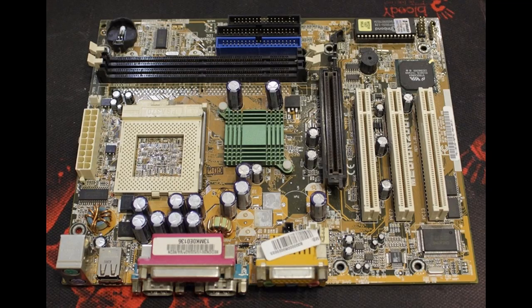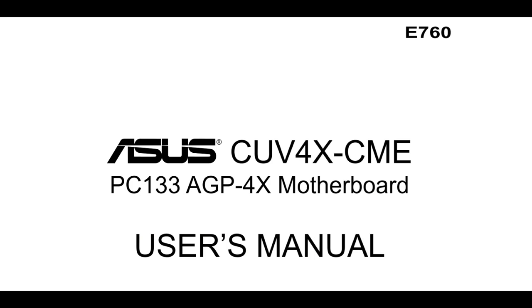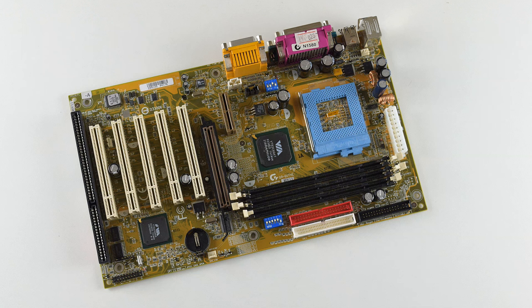So let's start with the motherboard. It has 'Aldi 2001' written on it, however it's an OEM version of the ASUS CUVX-M motherboard. It's got a VIA Apollo Pro 133A chipset, is compatible with AGP 4X, and has 3 PCI slots and takes SD-RAM. We're going with a substitute from Gigabyte, which has a slightly newer revision of the same chipset — the VIA Apollo Pro 133T.